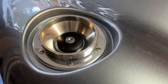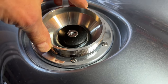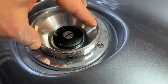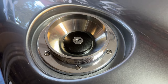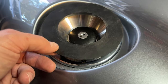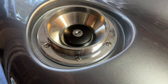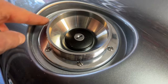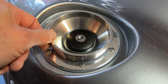Getting the rest of the lights on the front. Now the fuel cap does not sit flat on this little cut-out, and I don't want the fuel cap cutting into the paint before everything's done up tight. I'm going to mount it on a sheet of rubber - I've cut it out and I need to do the holes. It'll start biting into the rubber which will give a little and allow everything to be done up nice and tightly without biting down into the paintwork.